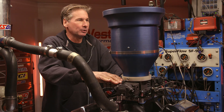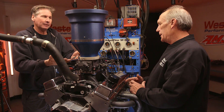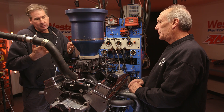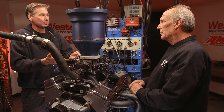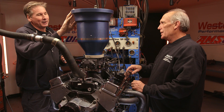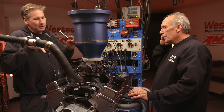How much CFM you're pulling through depends on how much pressure is pulling the air through it, and that has to do with engine size and volumetric efficiency. They have to have a standard for rating, and the standard is one and a half inches of mercury. But is that what the carburetor is going to see on a running engine? Not necessarily. You could put the most gigantic 1,250 CFM carburetor and it's not going to shove that air into the engine by itself.